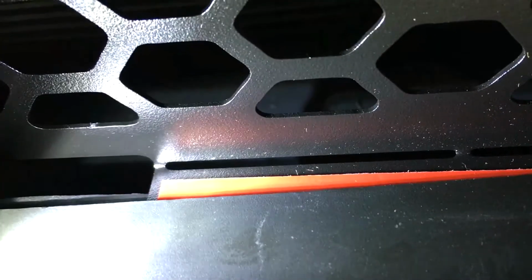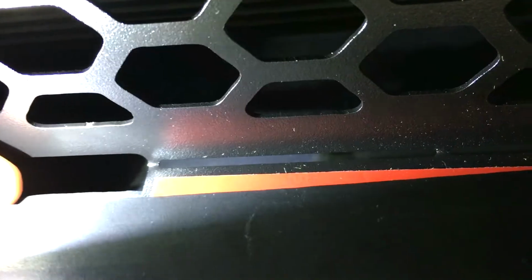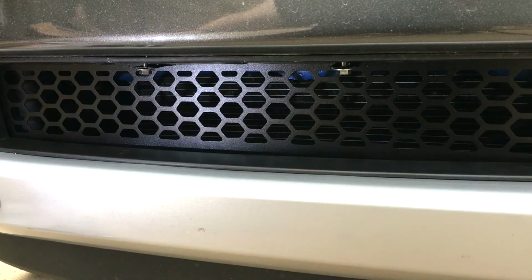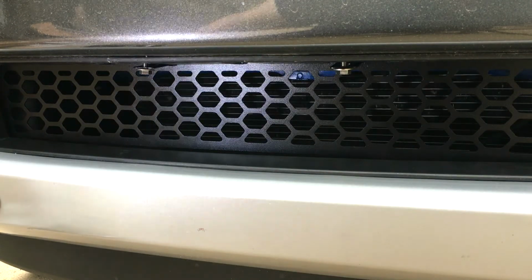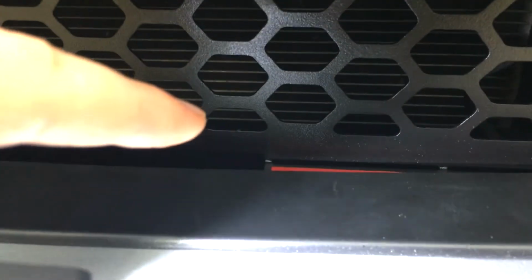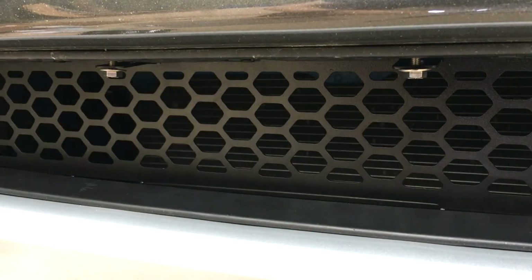It's hard to see on video, but there is a little bit of foam down here that you'll have to wedge the tab in between the foam and the lower bumper or fascia plastic. So now that we've got things all lined up, there's really not a lot of side-to-side movement in this. So now we can undo the double-sided sticky tape, and then once it's in place we can tighten up the 2 bolts, and that should be it.